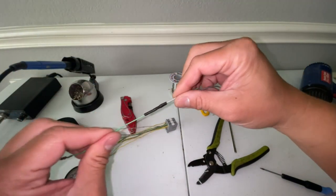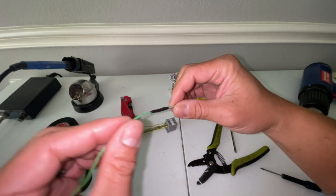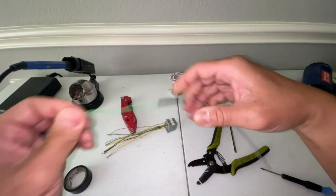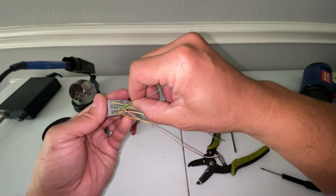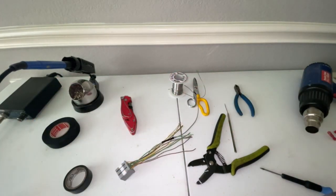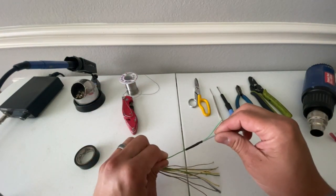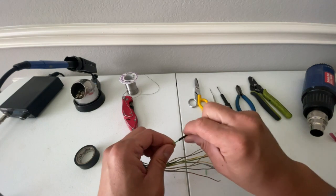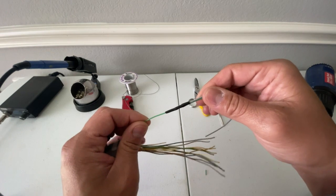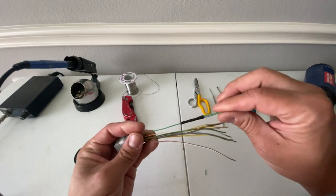The heat shrink tubing I use is water-tight or water-resistant heat shrink tubing. When you apply heat to it, it releases a liquid on the inside that creates a nice seal. That's the way I do it, and then you reinsert it back into the cavity it came out of and lock the TPA down. If you don't have access to a soldering iron, solder, or even a heat gun, you can perform the same steps. You can use a lighter to heat this — just be careful not to burn the wire. Keep the heat constantly moving and that'll achieve the same result. If you can't add a heat shrink tube, you can use electrical tape once you've spliced the wire.